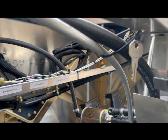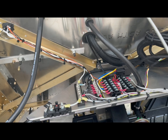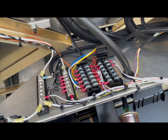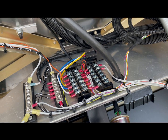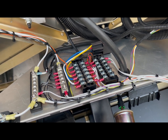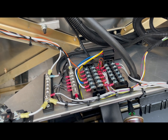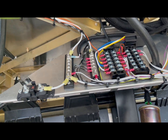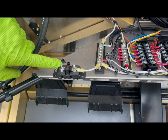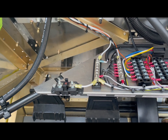We've got a wiring system based on the drawing on our website — they're all the same. Here we have some bus bars where everything for the engine is grouped into one location: fuel pumps, the engine itself, power for the engine, alternator, and all that. This is a dedicated area — a no-go zone for any airframe wiring. Then over here we have 30 amps coming in, with a separate terminal for the rest of the airplane, which protects the engine and keeps it running in case something fries in the airframe.